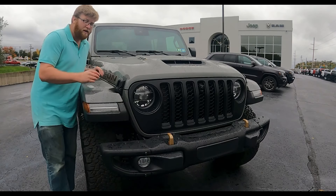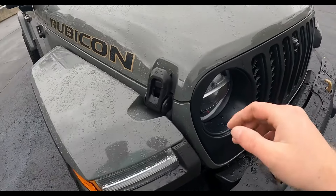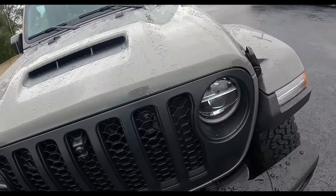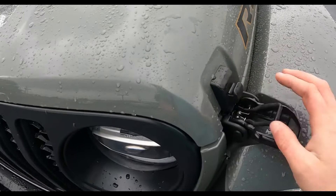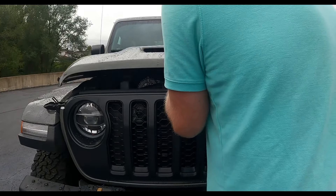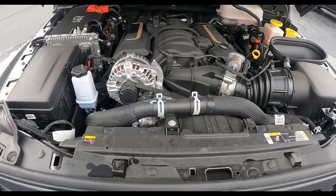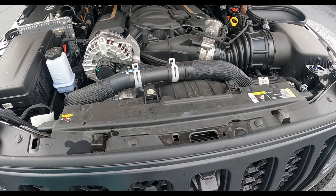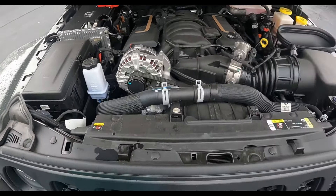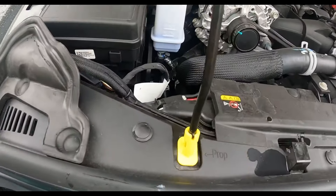Getting into the hood of the Jeep is a little different — most new cars have a hood release on the inside, but this just has latches that hold the hood down. You open them, then there's a clip inside — make sure the clip's off, do that for both sides. There's also a latch inside to protect it from flying up, and just a standard hood prop. If you're new to Jeep like myself, the prop is actually at the top of the hood, where there's a location that says 'prop.'